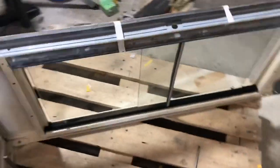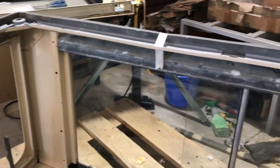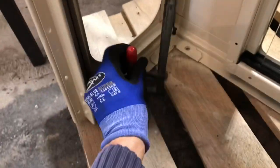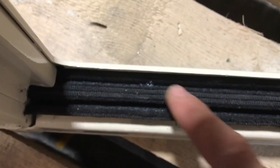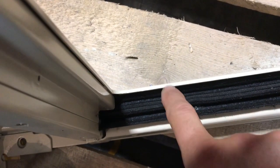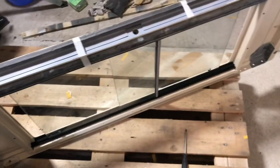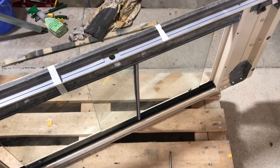I've got the glass in on that final side panel. I've had to tape up these seals just for holding them in place when I flip the side over. I haven't glued those in but I'll probably do that a bit later, or not at all - we'll have to see. They clamp in there pretty well. I've got the screws in on the top here - they're quite tight but that's nice. You have to really screw them down into the felt, sort of hiding the screw into the bottom corner of the runner, so that the glass doesn't scrape on the screws. It took a bit of time to get them in because every time I tested it there was a scrape somewhere, but they're in now and I'm just going to put it on the car.